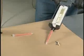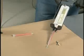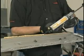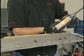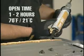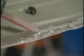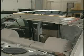Then attach a mixing tip and dispense a small amount of material until uniformly mixed. This is a key step in all repairs. If foam is present, begin by applying Fuser factory match urethane sealer adhesive stock number 800EZ to the reinforcing bows. Fuser 800EZ has an open time of 1-2 hours, so you will have plenty of time to complete the roof installation. Next, apply a 10-12mm bead of adhesive to all prepared edges. Depending on your fit situation, additional adhesive may be needed in certain areas.